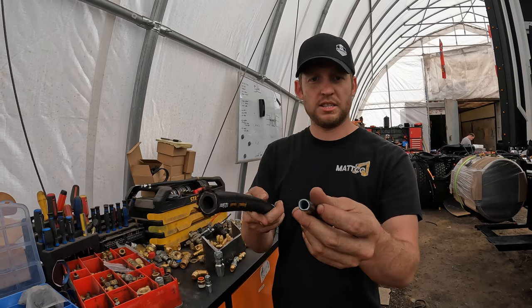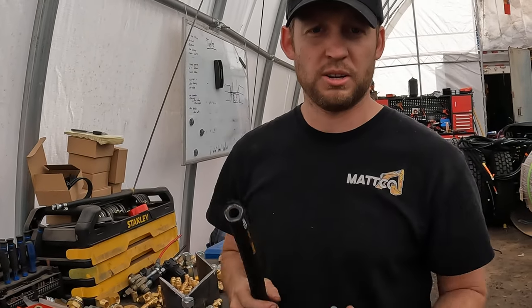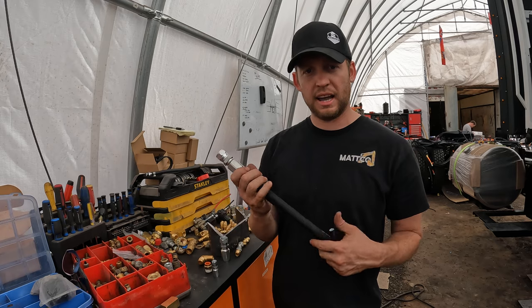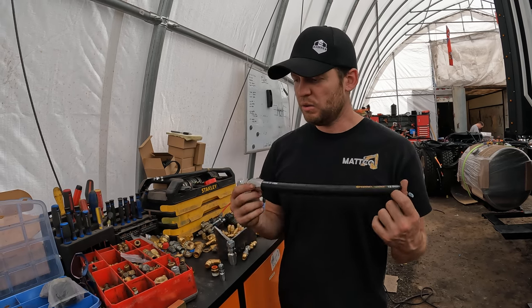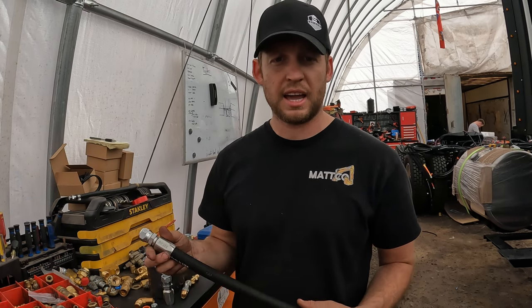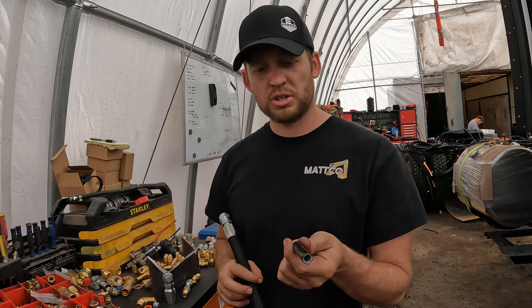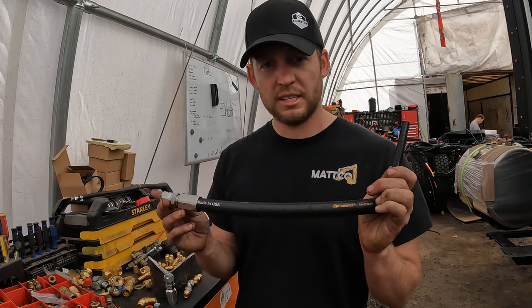Have a look at the difference in wall thickness: your nylon versus your steel braided — take a guess which one's going to last longer on your truck. Yes, you're going to pay a little more — about a dollar fifty to two dollars a foot for steel braided. But if you add up your time and downtime costs, going from ten or twenty cents a foot up to two dollars really makes a difference. One hour of breakdown on a truck running a hundred feet of airline pays that extra two hundred dollars for the line. You're out in the field, you've got to call a service truck out — service call fees alone cover the upgrade.